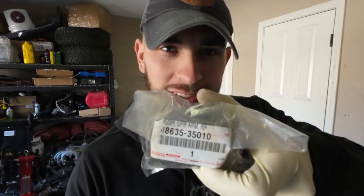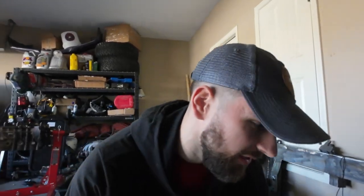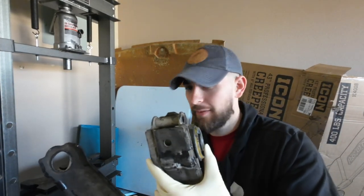It's been about a week. I ended up ordering the wrong rear bushings — the bigger ones — so I had to wait for the new ones. Now I've got them and I'm going to press these bushings back into the arms. I've only done one arm. I'm not going to show the second arm because the process is the same. I will show how I pressed out that big bushing though since I didn't capture it very well. I'm going to do this in reverse order: press the large bushing in first, then put the little rod back, then press the small bushing in on this side.